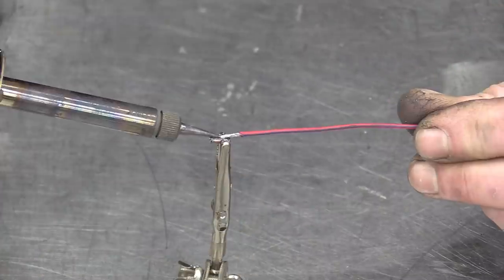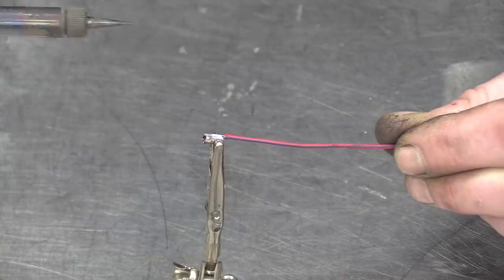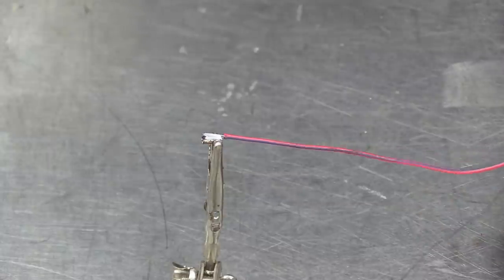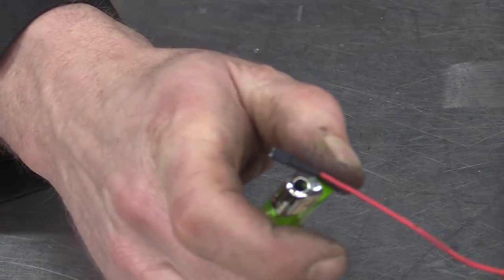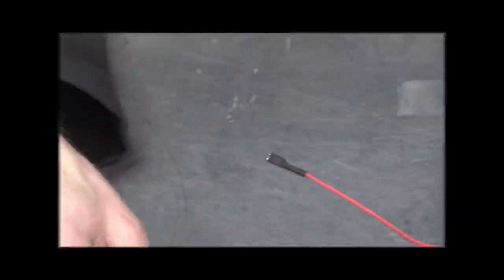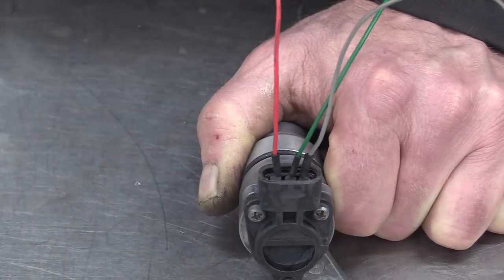We've done very little soldering on this project, thankfully, but here we can't help it, as the crimped terminals stick out past the top of the plastic housing, so Nick's cut them off and whipped out the soldering iron to attach the wires in a low-profile stylee. The heat shrink is almost certainly superfluous given we're potting the whole thing, but they're all done now, and we're ready to release the shmoo.